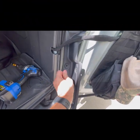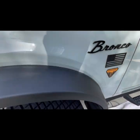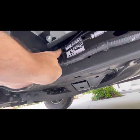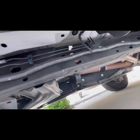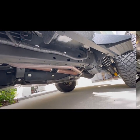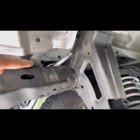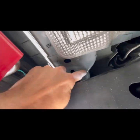Now you can go ahead and put these trim pieces back into place. For the cable, I just ran it down straight through here — you can see it popped out right here, zip-tied onto this — and I'm going to run it along the frame, up and over the top, and run that all the way down. On the driver's side rear wheel I came up and over the frame, zip-tied up here, then ran it back through and it drops down.